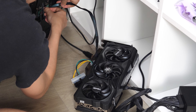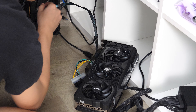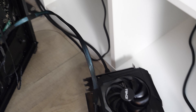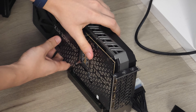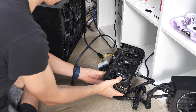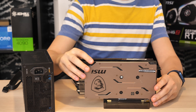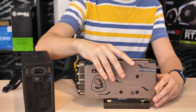Since I'll run benchmarks on a PC, I'll use an M.2 adapter and plug the Oculink cable into it, and I ended up with this weird setup. The eGPU dock is too small to hold the graphics card in a standing position, and I couldn't find a case or stand for it. So if you plan to get a dock like this for a big graphics card, think twice or just get another one. The RTX 2060 seems to hold up on it, but it's painful to watch.